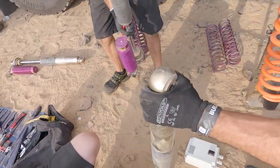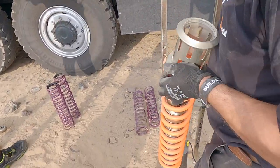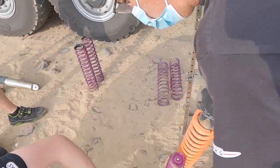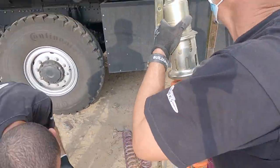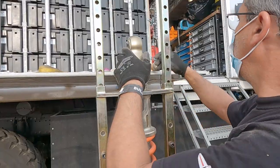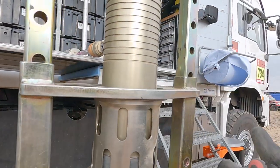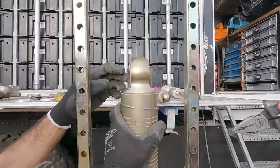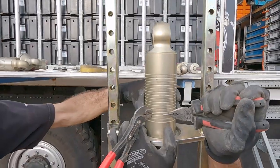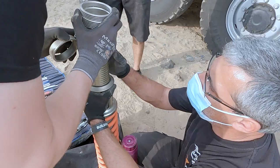Spring off. Second shock. Spring goes on — and then you do everything in reverse. That's the distance piece, which is the distance keeper. Put it back in the spring press. Put the spring down now. Put it in at the top — it's fixed. That's the safety clip again. Safety clip goes in, and now it can go into the car.